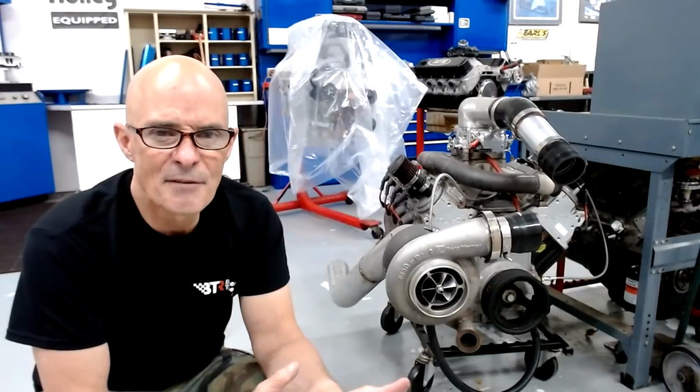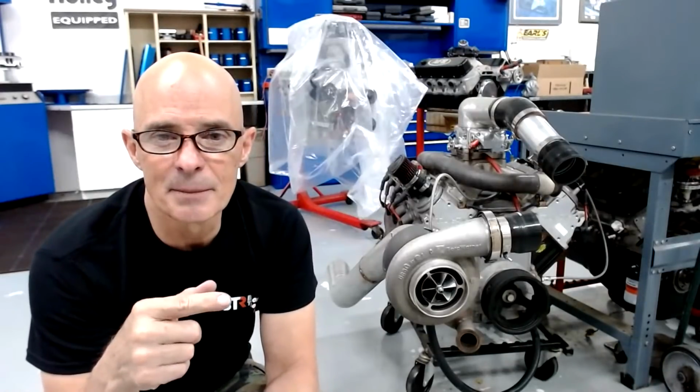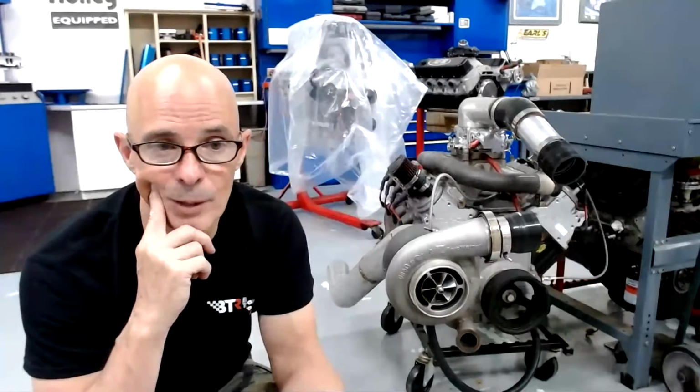Turbo Tony, under boost, how much horsepower can the stock truck coil packs with heat sink support? How much boost can they support without the spark being blown out? One of the problems you had there, I don't know about those coil packs specifically. We normally run the LS3 style, but unless you have the ability to manipulate the dwell time, I don't know where they would run out, because if you only have 1 millisecond or something, it's not going to work as well.